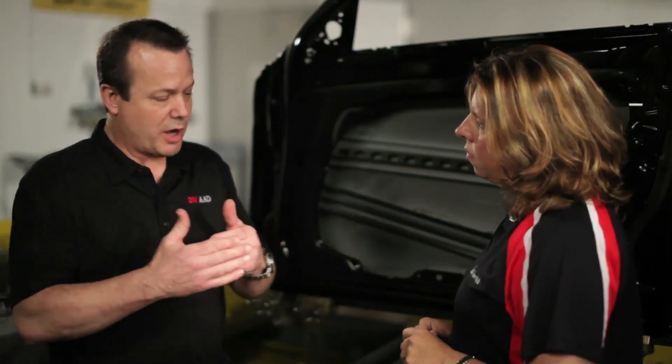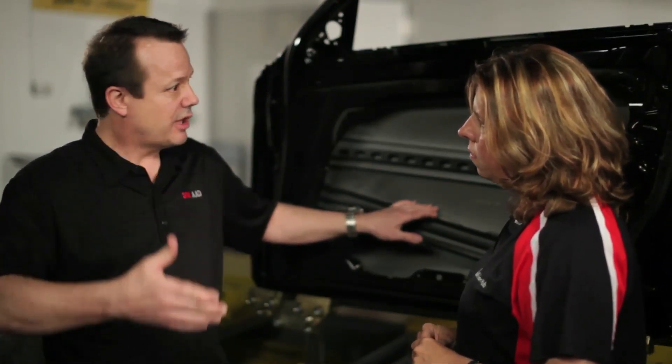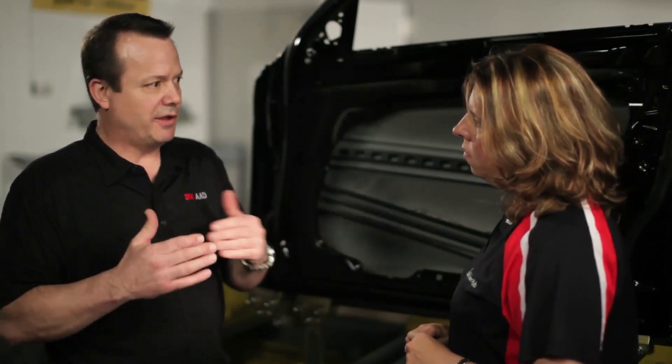Are there any standard operating procedures a shop could put in place to make sure the technician is always choosing the right material? A lot of shops do have approved material lists, and that would be a good place to start. Select a noise vibration harshness material for reattaching foam or filling very small gaps, and a flexible foam for operations where you want that flexibility. Keep in mind this same type of product would be used on roof skins, on van sides, and all kinds of things where there's a supporting beam behind the panel. We always want to have that flexibility between those two panels or you may see ripples on the outside.